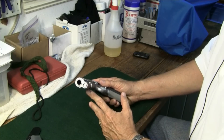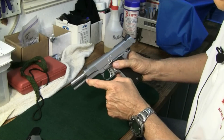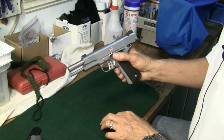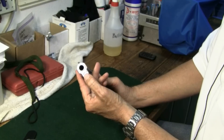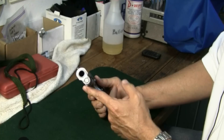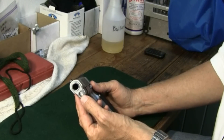In order to take this down and field strip it, we're going to take the barrel as well as the recoil spring out the front of the gun. Now some of the Kimber compact models — you rack the slide back and there's a little pin hole right here that you put a little paper clip type device in. It holds the spring intact as you take down the slide. But this TLE-2 does not have this little hole, so it takes down just a little bit differently. We're going to need to push the recoil spring plug, which is under a lot of tension, back just enough so that we can turn the barrel bushing clockwise, unlock the plug, and allow it to come forward. You've got to be careful because the recoil spring is under a lot of pressure and it'll shoot this plug out like a bullet — hit you between the eyes. So you've got to be very cautious.